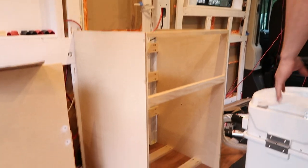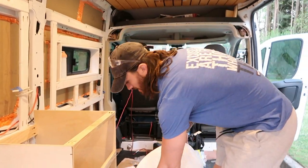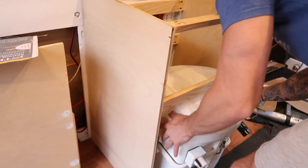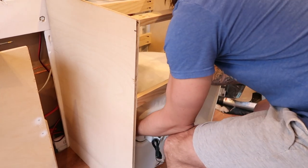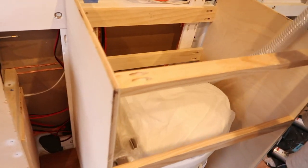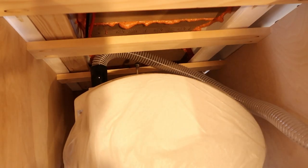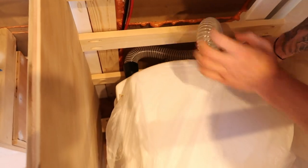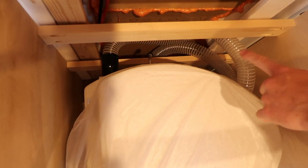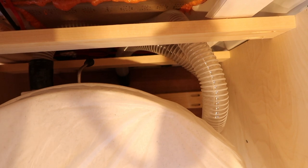This Nature's Head composting toilet is what's going to be inside of here. It's going to be on some heavy duty drawer slides, just in here like this. The reason why we didn't put the back plywood on it is for the scent vent tube — it would have been too far back. So what we're doing is running it back behind there. I'm going to route that down, run it through the floor, drill through the floor so that the vent will go straight out the bottom of the van.